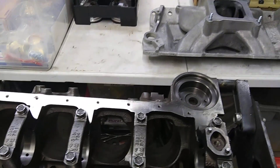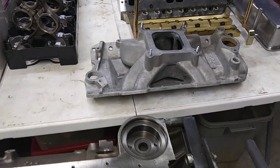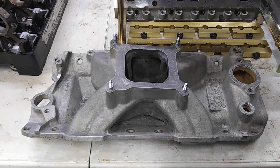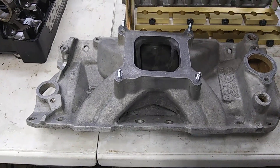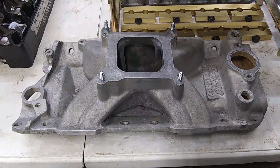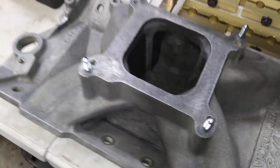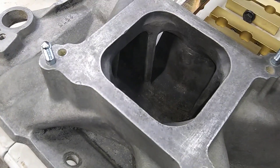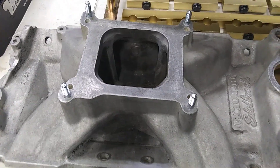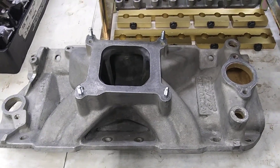So I just gathered up shit I have laying around my garage. This is the intake I'm going to use on it — a 1979-1980 vintage little Edelbrock Victor Jr. intake manifold. Slightly cleaned up, port matched. I think it's port matched to a 1205.